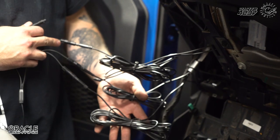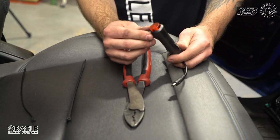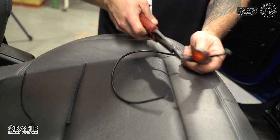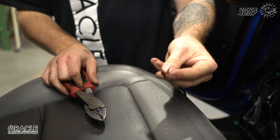We've secured our light heads to the harness. Now we're going to plug in our four cables to our Bluetooth controller, making sure to line the arrowed keyways up — that'll ensure these work properly. The kit comes with an easy wiring adapter with a cigar socket and on/off switch, but we're going to hardwire this today, so we'll cut that off, strip back the cabling to expose the red and black wire, and use those to hardwire.